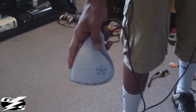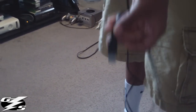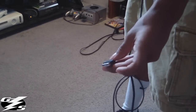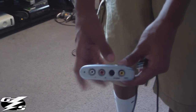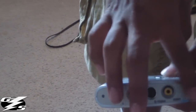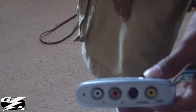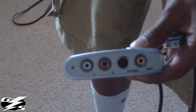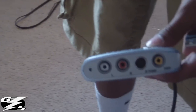Here is the Dazzle right here. It has a USB connector to go into your computer, laptop, or Mac. The connections on it are S-Video, left and right audio, and the yellow video slot which is a composite. The Dazzle does not record HD because it is a composite and S-Video input, so it only records up to 480p.